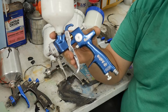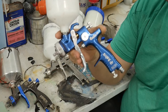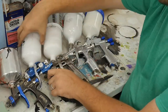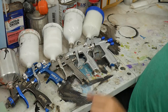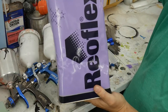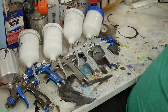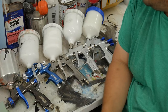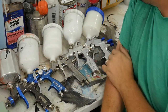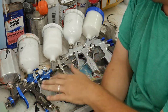The Astro puts out a monster fan, and I was so impressed with the primer gun that I had to know if the clear coat version would also put down a nice two-to-one. I've been shooting Real Flex ultra high solids — that's 65% solids, super thick — through all of these guns with a 10% reduction mixed to the 60-minute cure time. In the next segment I'm going to show you some test panels. Like I said, if I had to pick one, I'd pick the Astro.